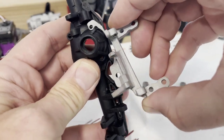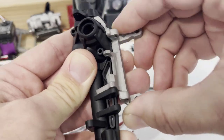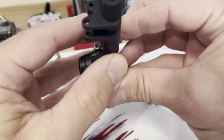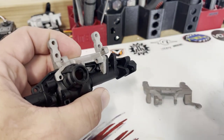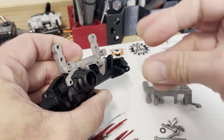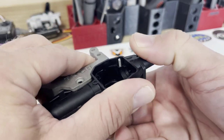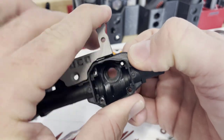The easiest way I've found to do it is to pop that into place and then just slide it on down, and it should give you a pretty flush fit. You've got a couple of options for the links, but the first thing you're going to want to do is secure behind the back of the pumpkin. For that, you're going to use the M2.5 by 20 — it goes through and hits the back of the pumpkin, or the back of the diff cover, all the way through the pumpkin. That's going to be part of the mount.